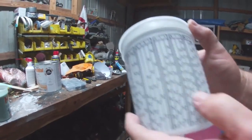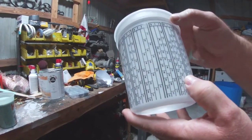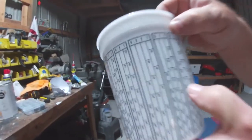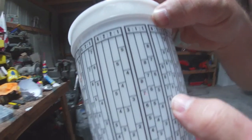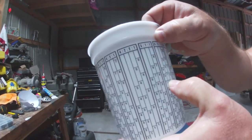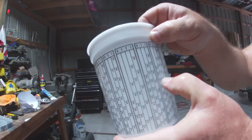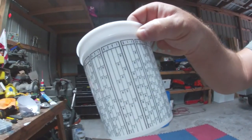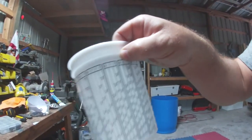Six to one to one. So the first number in that column — let's say we're going to go with six ounces as paint. Then we move over to the next column, we find our next six. So that's where we pour our hardener up to, and then the next six is where we pour our next mixture up to. You mix it all up, and then we're ready to spray.